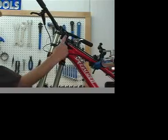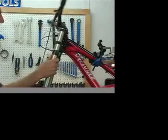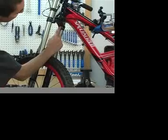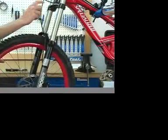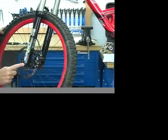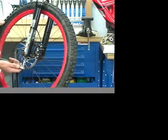On all high-performance downhill, freeride, and extreme forks, inspect fork for damage of the stem, steer tube, upper and lower crown assemblies, right and left upper stanchion tubes, lower legs, and through axle retention systems. Rotate fork side to side to verify brake and derailleur housing is secure and is not being pinched or binding under load. Secure all fork fittings to manufacturer's recommended torque values. If you have any fork performance issues or concerns, have an authorized service center check your fork.